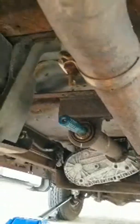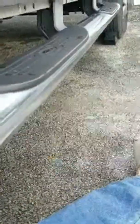It's a 2-part drive shaft. So I got a rear bearing there, so I'm gonna have to take that out. I figured while I got this out, I'm gonna put all new. It's got not just shy of 100,000 miles on it. So I figured I might as well change the bearings and the U joints and the carrier bearing that's under there. And get all the rust off of it. Everything's really rusty under there. So I'll get the rust out of it also.